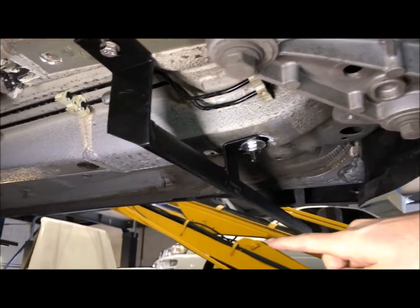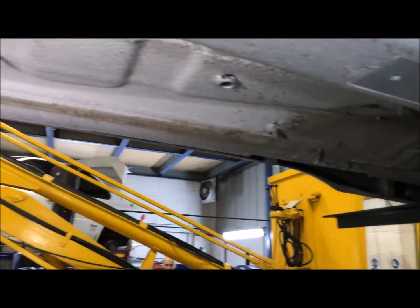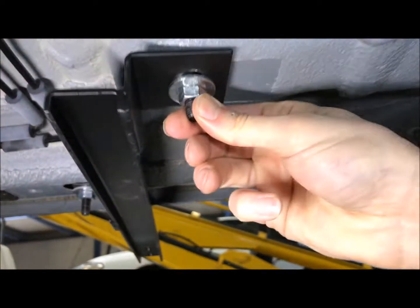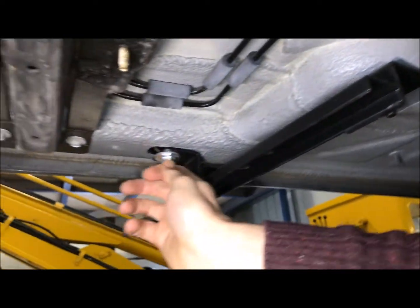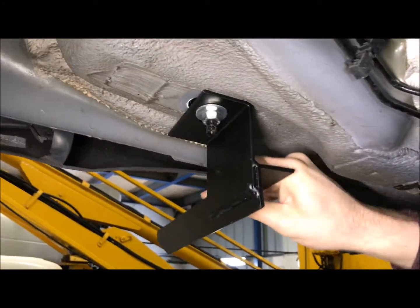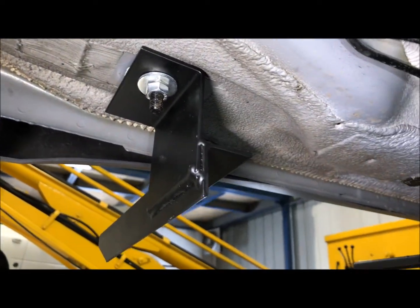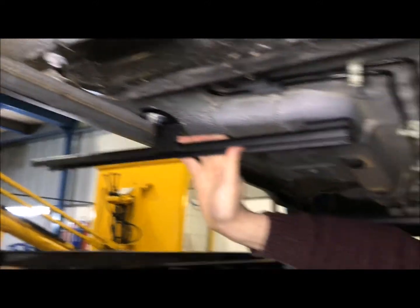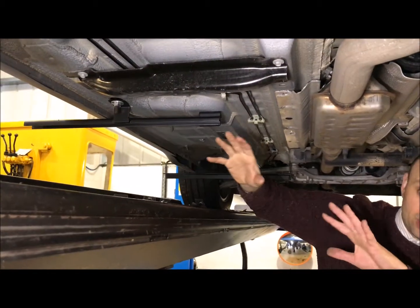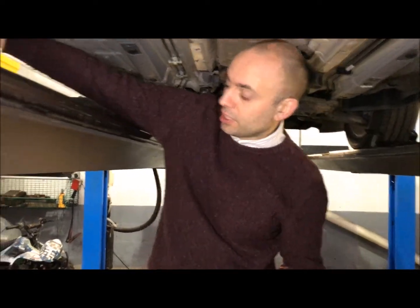If you go further down to the middle brackets, you'll notice there's quite a big gap before you actually get to the middle bracket. The middle bracket's actually closer towards the rear than it is to the front. Again, that's a T-bolt in there into that section, T-bolt into here holding it into place, and that's pretty solid. And on the rear bracket, you've got a T-bolt here. Now obviously you're thinking, well, that's just one hole on there, but that doesn't make much of a difference because you've got 3 brackets on this kit. They're about a 70-inch board, so 3 brackets is more than enough. And anyway, the middle bracket's, like we said, more towards the rear to support that weight. And then when you stick the boards on, they will mount to this point here.